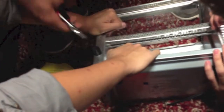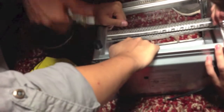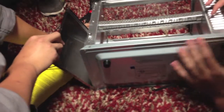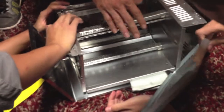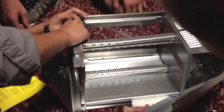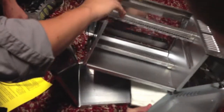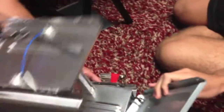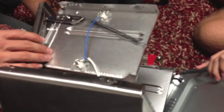The legs on the toaster were bolted into the steel body, making them difficult to take off; we had to use pliers and supply a good deal of torque before removing them successfully. Fiberglass insulation was placed between the roof of the toaster oven and the top of the outer shell, but it was cut in an odd shape that did not match the rectangular shape of the top — it almost seemed as if it was left over from a previous model and thrown in during production. The door had a spring mechanism that allowed for easy opening and closing, helping the door stay shut during heating.